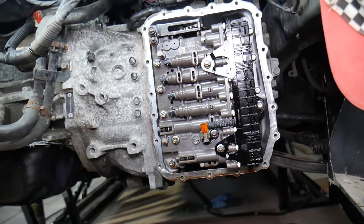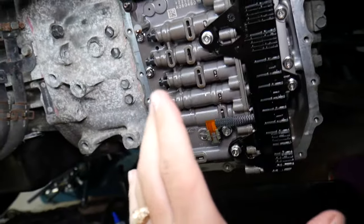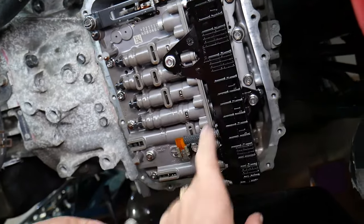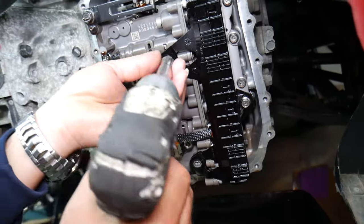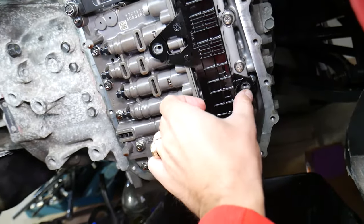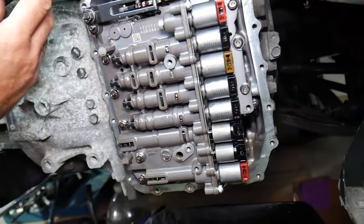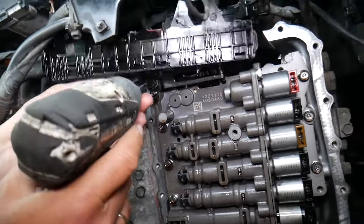If you want to see videos about testing solenoids or how to fix a transmission that doesn't shift, is slipping, or has hard shifting, we'll have all those videos on our channel. Once the oil pan is removed, you can see right here we need to disconnect the wiring harness for the shifter solenoid. On this transmission we have three bolts for the wiring harness and one for the transmission fluid temperature sensor. Some may have individually connected solenoids — it depends on the model. Remove the sensor carefully — just grab and pull it out.